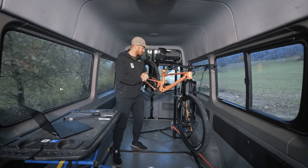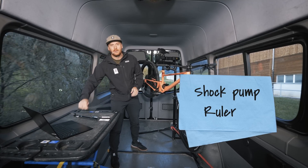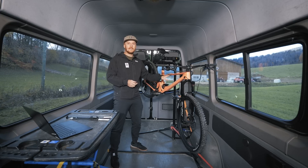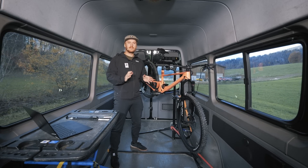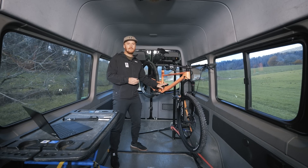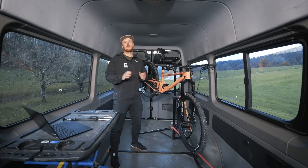So how do I set up my suspension and what tools do I need? Basically quite simple — a shock pump and a ruler. The 4060 LT or ST, same for our e-bike the Z family, have been developed to work between 28% and 30% sag. With 65mm shock stroke for the long travel, 62.5mm for model year 22, and 57.5mm stroke for the short travel one.